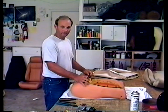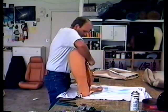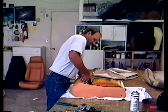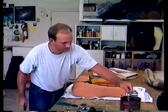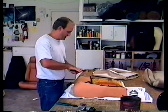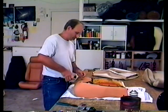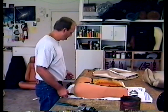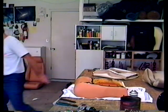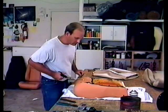Leather stretches, so this front tab hooks back here — you can see real easy where those went. Give a little tug on it and hook it down in the middle first, then on each side. At the front, make sure you can still see these little bolts — it will make it a lot easier when you put the tracks back on if you can see them all.